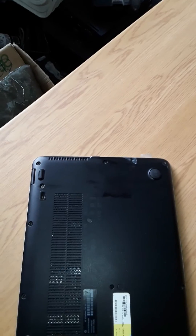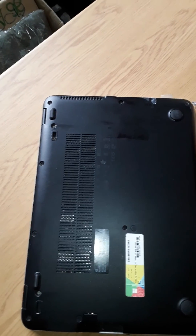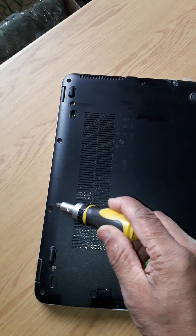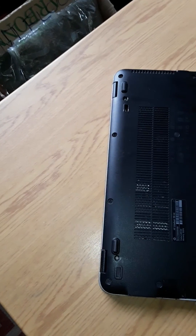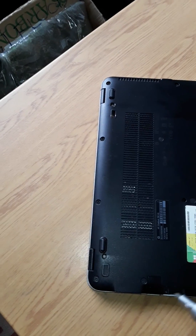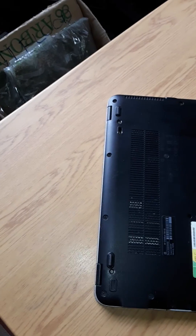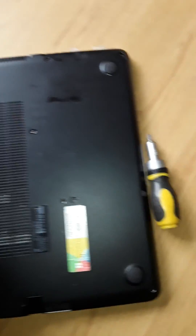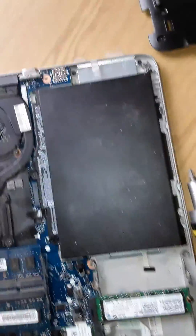What you need to do to take the back off is remove the rubber grommets here, here, here, here, here, here, and the two under here. If you remove the SD card, then you can take the back off. The screws are off — just lift off gently and put it to one side.